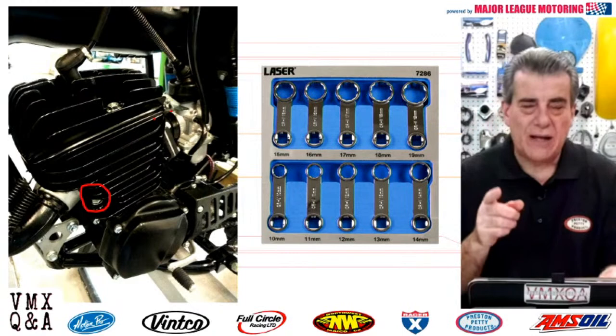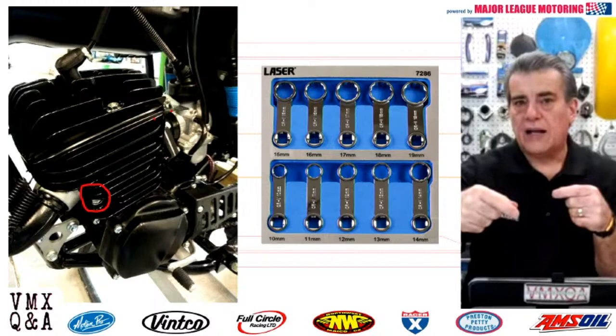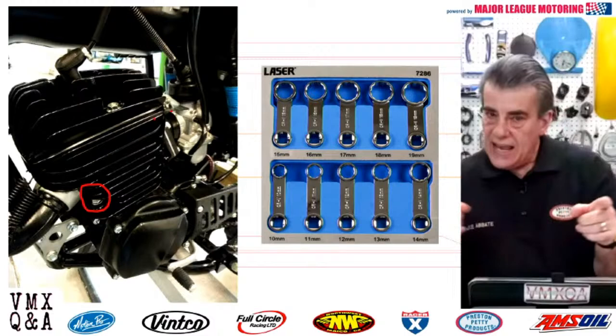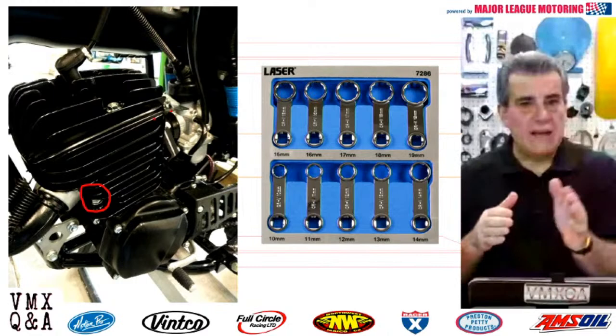Because you have that extra 2 inches on that wrench, making your torque wrench a little bit longer, if it says to torque those nuts at, I don't know, 22 or 24 foot-pounds, that extra length from the extension you're using means you may have to cut back on the foot-pounds of torque because you have a longer tool. It's going to give you more leverage.